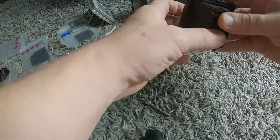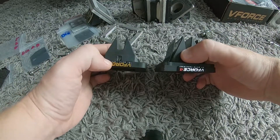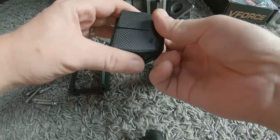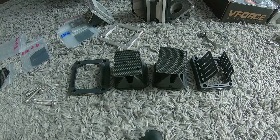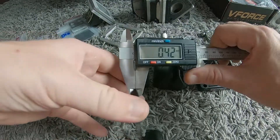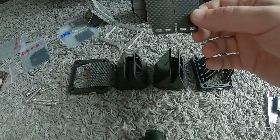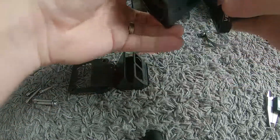Let's compare the V-force 4 and V-force 3 reeds — something interesting. These are not the real ones — they're a lot cheaper than the regular ones, but I see a lot of guys using them here. The V-force 3 reed comes in at 0.3 millimeters. The V-force 4 reed is 0.42 to 0.43 millimeters. So the V-force 4 is by far the thickest of all the reeds we've looked at today, even the custom-made Thai ones. These are certainly suited for a much more powerful engine.